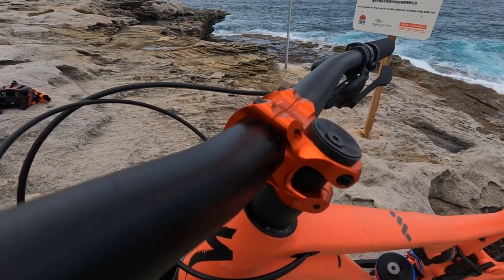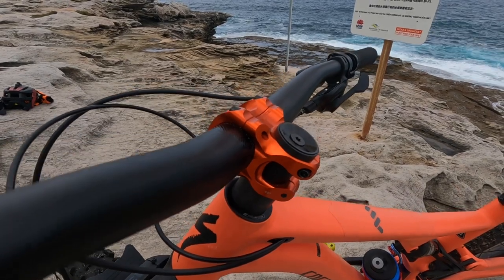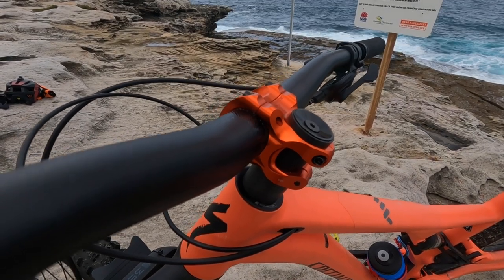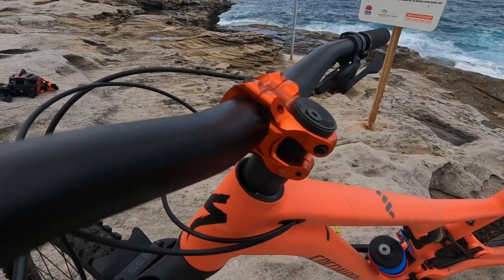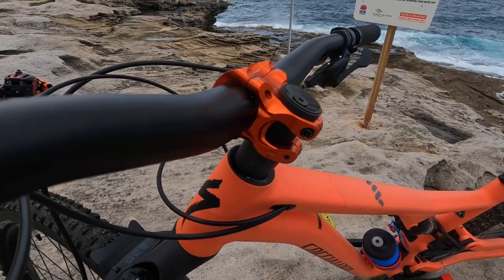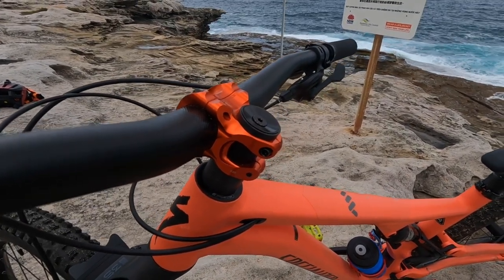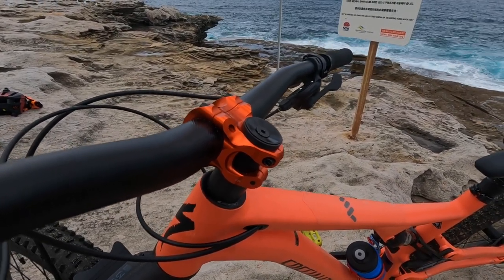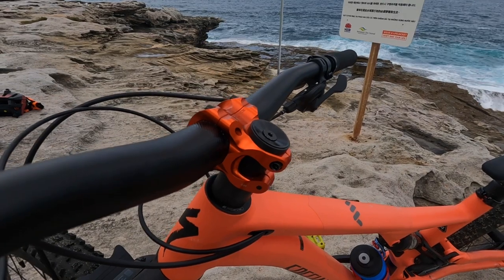So what it's really achieving for me is a shorter reach. The reason why I'm doing that is not a technical reason, but for the fact that I'm getting sore wrists every time I'm riding. The reason being I'm reaching forward a lot to get those bars, so I tend to lean a bit more, my weight a bit forward, so the weight's sitting on my wrist, which is the wrong way of doing it. But what I've done now for about a month, having this new stem, has got me to evenly put my weight on my feet, which means not putting the weight on my wrist, which I'm now finding at the end of each ride, I don't have aching wrists anymore. That has made a bike which I was sort of regretting in the beginning, into one I'm now starting to get really quite used to, and what this bike can do.